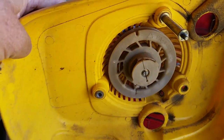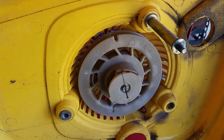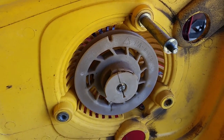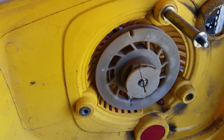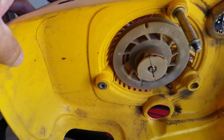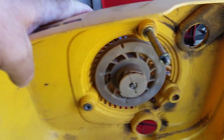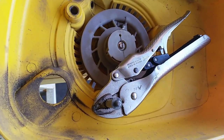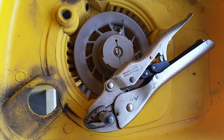It's what will often be the case with these Talon lawnmowers — I'm trying to get the starter cowl off. This mounting bolt here will be jammed to the nut and the only way it's going to come out is being rattled out. We'll repair that when it goes back together. How we're going to get that nut undone is we'll grab the shaft there with the vice grips and use the rattle gun and rattle it off.